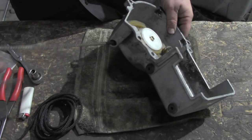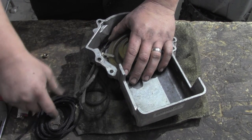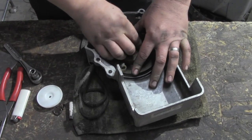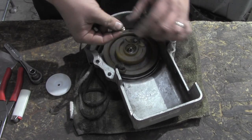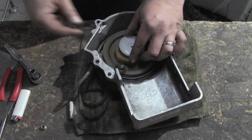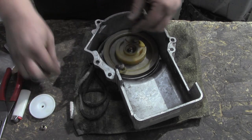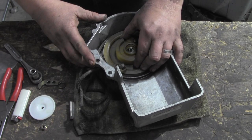So, stuff's messed up — that's what's going on inside your recoil. The biggest thing: we're gonna take the bolt off the middle, it's usually about a 10mm, pop that off. This disc that's next — that's gonna come off. Then your little dog and spring here, that's gonna come out. Now we're down to the pulley.